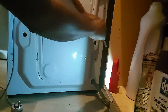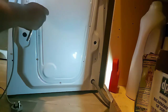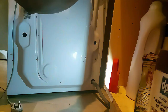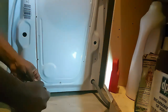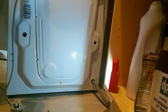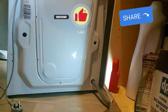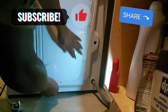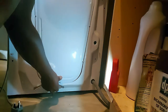So you just take apart the seven screws — they're quite easy to take out. Remember, the first thing you need to do is unplug your washing machine from the wall. You might not need to take out the pipes if they are long enough. That's the back panel.